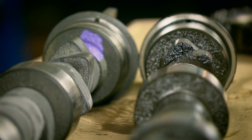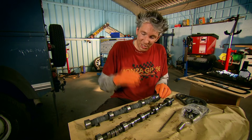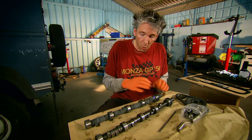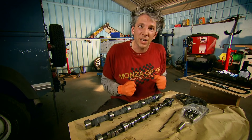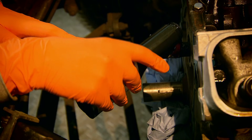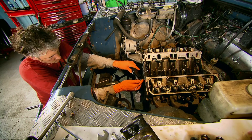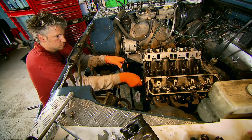Our brand new cam — the Viper Hurricane, which already sounds much more exciting and powerful — is designed very much for this job. It's got perhaps 20 brake horsepower more than a standard cam, but the main thing is the power is right where you need it, in that bottom-end grunt. This really is a full-on job. You could tackle it at home, but I'd suggest you leave yourself plenty of time — I've got 50% of the engine parts on the bench. If you can manage it though, it would save you around £400 in labour from an off-road specialist.